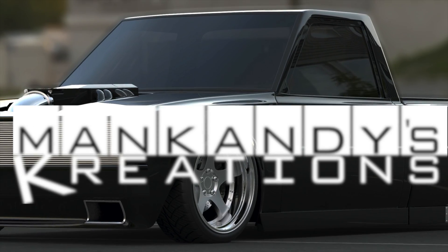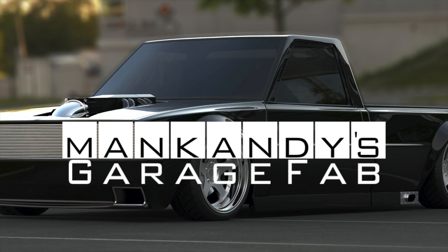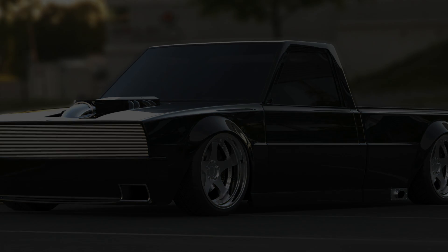Today's project is a custom fuel cell — a very simple fuel cell. 16-gauge sheet metal, just a box, probably six sides. If there's anything fancy about it, it's that I'm going to be using all the parts from the factory Mitsubishi Eclipse fuel tank: the fuel pump assembly, the fuel sender, and the openings in the top of the Eclipse tank. I'll be cutting those out and welding them into my tank, and I'll be lining the inside with POR-15 fuel tank liner — which I've never used before, so we'll be learning together.